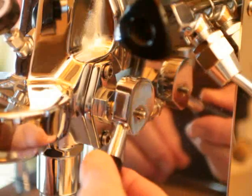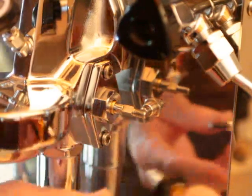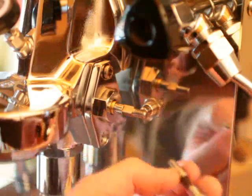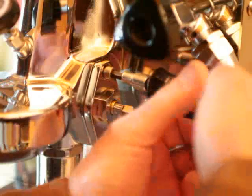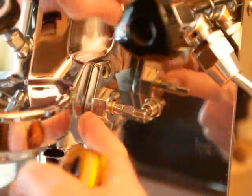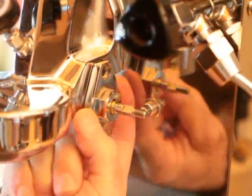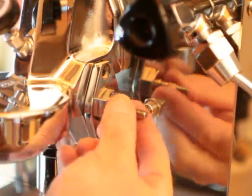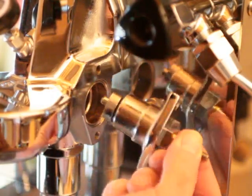Again, the shaft should be in the middle position before you remove it. Check that. It's important. It makes everything else a lot easier. You might have two socket head screws, as I have here on the VBMA. If not, you have two hex nuts or hex fittings here. You want to loosen the inner one. Get the handle out of the way and unscrew it from the one closest to the group. Once you've got that, here in the VBMA, it just wiggles right out. There's the cam.